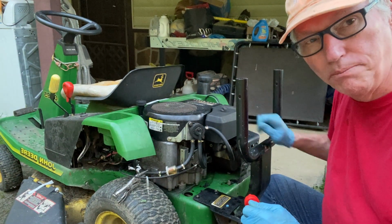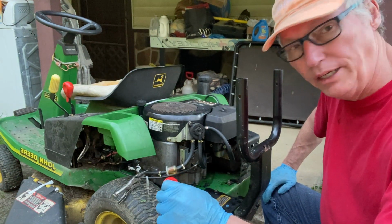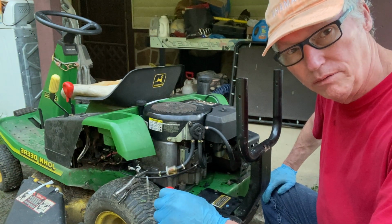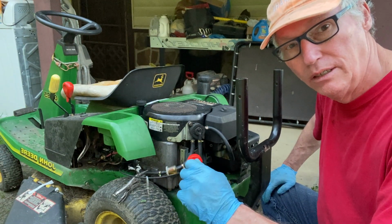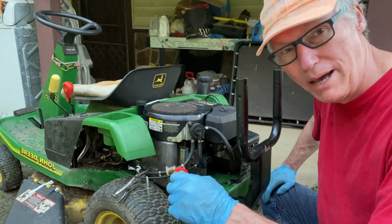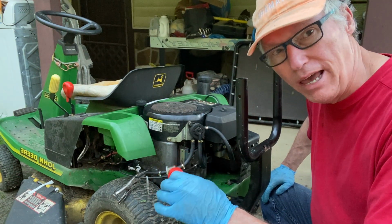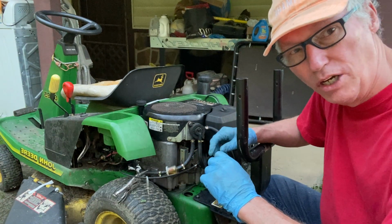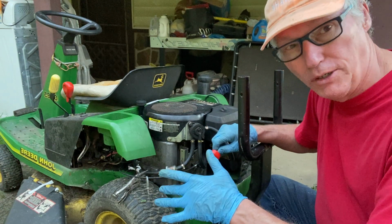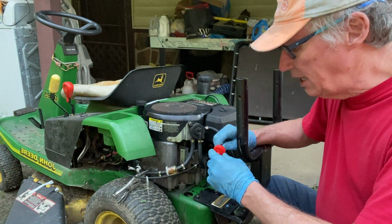Also, right now, I'm not going to put the carburetor on yet. The little spring that goes on that carburetor choke kind of broke off. So I reattached it. You can actually pull on that and bend it right at the end and make another one without buying one. If you have to buy the part, just that little spring on that choke is over $100 at like AgPro. But you have to buy the whole kit. You don't get just the spring. So that's the catch there.